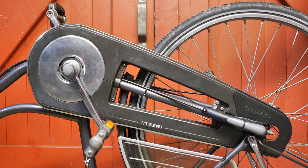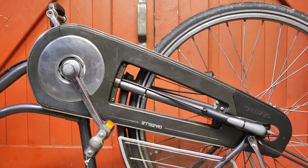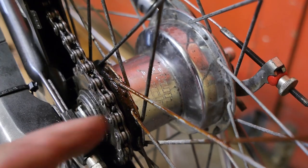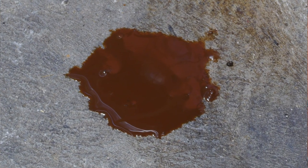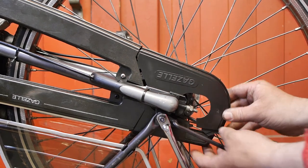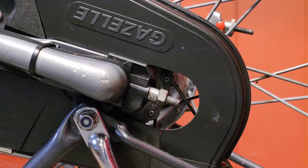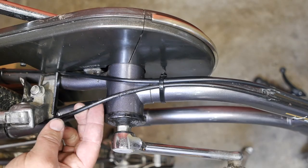But don't think this struggle is all over — that trim piece will come flying off and that will happen. I guess that's the reason why this rear piece was missing in the first place — just as difficult as a cloth chain guard, perhaps even more frustrating. The oil that I shot into the hub is coming out a little bit more brown than before — I guess that's not good for the bearings. After removing a little bit more material I think that solved the problem. Finally I'm done with this stupid chain guard — this chain case is not as close as I would have liked, you can clearly see the chain there. I think I found a reason why the rear brake cable was moving so stiff — there's some rust underneath the outer cable there, and another spot over here. At some point I should replace the whole cable.